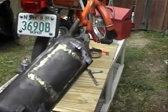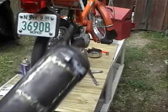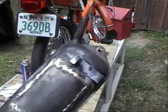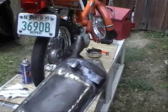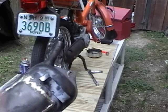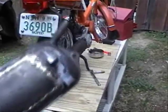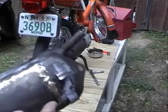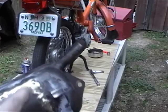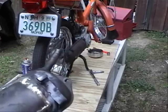This is the muffler that was cut and then brazed instead of welded. That's where we get that nice gold color, from the brass. But it works. All the holes are sealed up. The hardest part was that there's fiberglass insulation between this metal, and what looks like Swiss cheese type of metal. Between those two is the fiberglass, and it caught fire a lot, but like I said, it worked. Basically what I did was push the inner piece down, tack welded it, or tack brazed it, and then slid this upper piece down over that, and then as you can see, the braze.